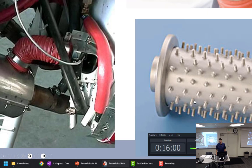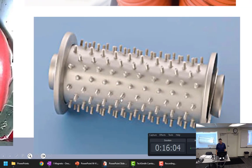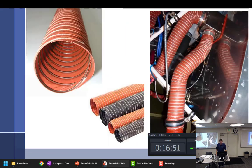The heat muff surrounds the pipe - it's not exhaust air going into the carburetor, just warm air from around the pipe. You can add screws inside to improve heat distribution. What happens if you get a small crack in the heat muff on the carb side? It'll run a little rich because you're depriving it of oxygen. What if it's on the cabin heat side? You are going to die - carbon monoxide poisoning.